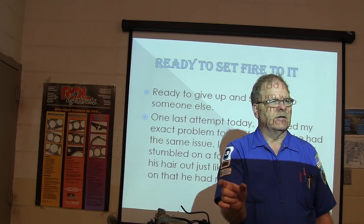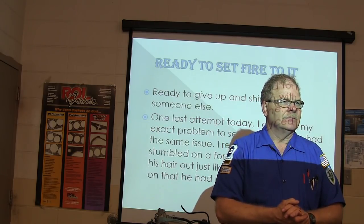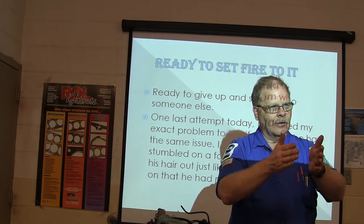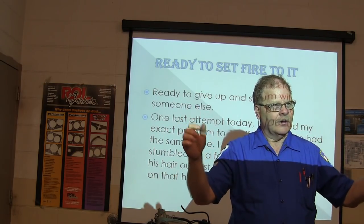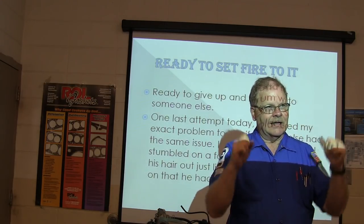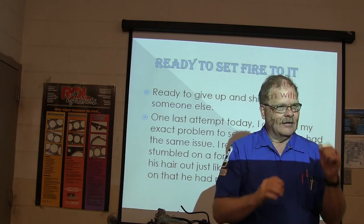Aren't these coils always going to fire companions? Yeah. On a straight six? Mm-hmm. 1 and 6, 2 and 5, 3 and 4. Those are the companions. Because you're going to see the ones on the outside doing this together. Then you're going to see the next two doing this together, although they're like this with the others. You'll see 3 and 4.